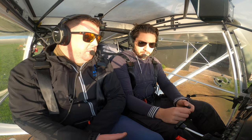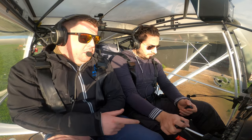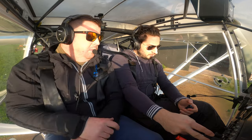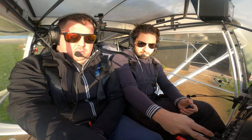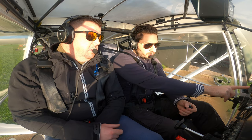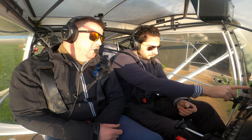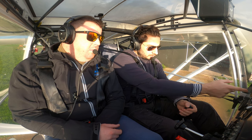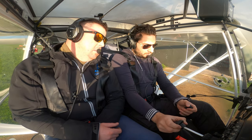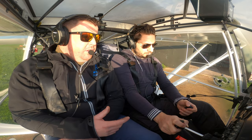Try and keep hold of the stick, but this one flops to neutral. I'm going to give it a bit of RPM — 3000, gently up to 3000. Best with your hand on top, and then you kind of roll it in. That's it — check no knocks, bangs, any smoke or anything like that. Then we'll try a mag drop. We're looking for less than 200 drop. Good drop, back on — two. Good drop, back on.